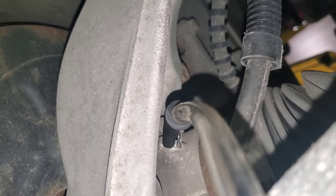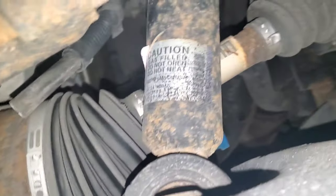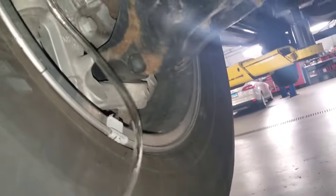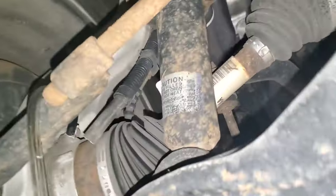I'm going to show you how to check your IWEs from the solenoid down. I grab the tire and move it with no vacuum on the system, and you can see the CV axle is actually moving with the tire. I pulled those vacuum lines off and have my vacuum tester hooked up to the big port — the little port is just a vent. There's no vacuum on it right now, so now I'm going to apply vacuum to remove the IWE engagement from the actual wheel bearing hub assembly.